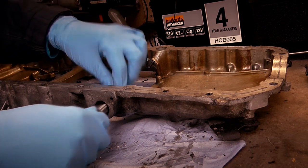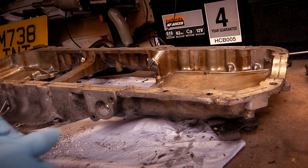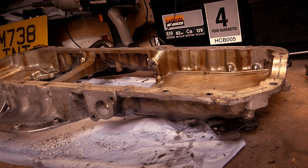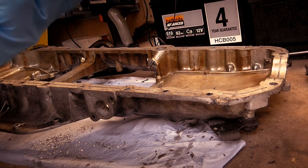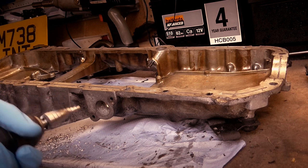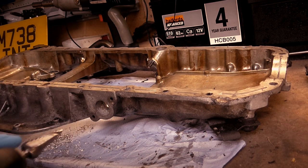And it goes up to 20mm, so I'm hoping if I can get all the steps to go through it, we'll have a 20mm hole. Bear in mind it's 12 at the moment, so that would be a lot better than what we have now. So I'm putting it into our drill. Need to line it up with the 12mm we already have, and then just go at it really.